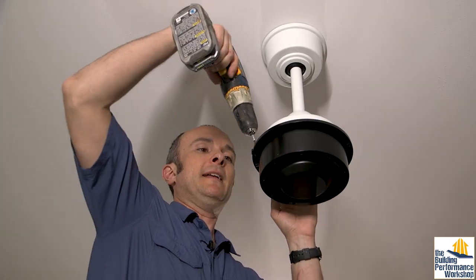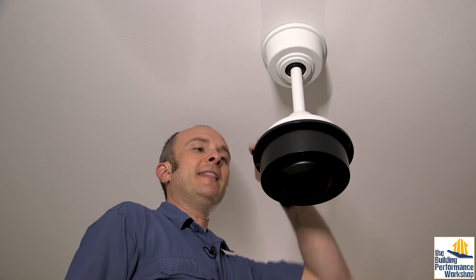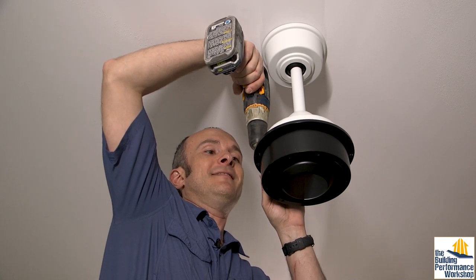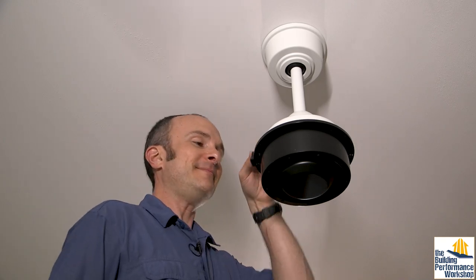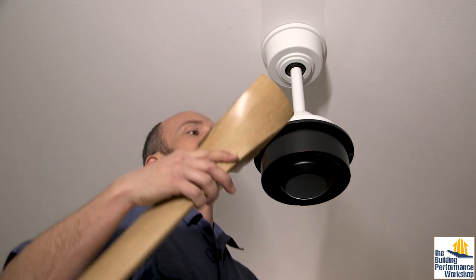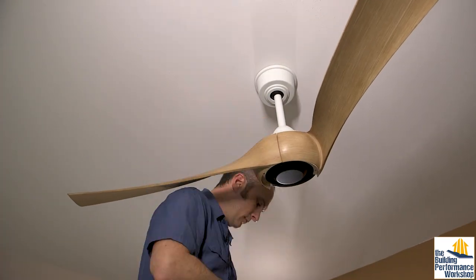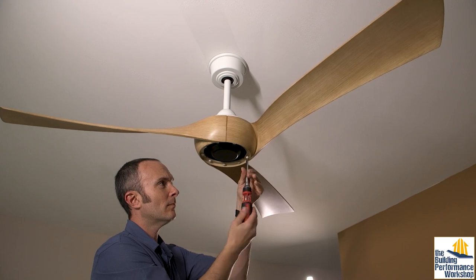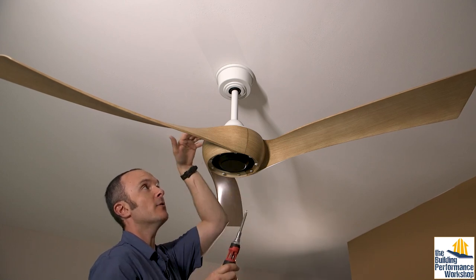This is called the motor guard — little pieces that protect from vibration during shipping. They come with all these little tiny screws. Don't drop the screws into the fan housing like I just did, and if you do, call Grace because she knows how to get that stuff out. Fanimation puts a sticker on the fan blades that says 'this side up' so you don't make that mistake. With machines, you want to put all screws in loosely first, and because it needs to be balanced, how you tighten everything down is important — tighten the bottom first, then come back and tighten the top screws.